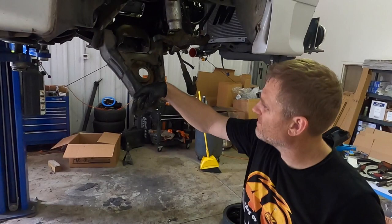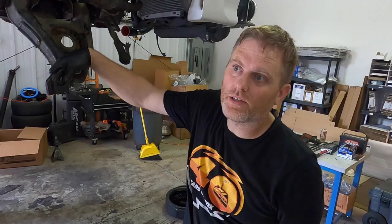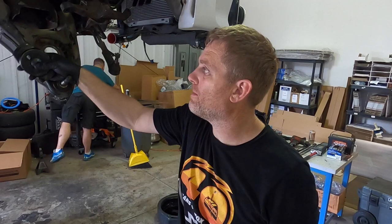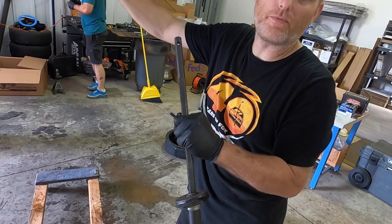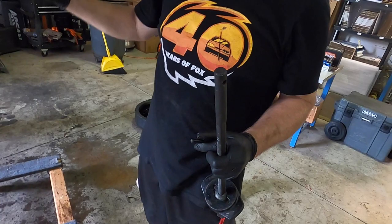We're going to do a little bit of how-to in this. Rob's tearing the motor down there, so we get back to that in a second. But Matt's got a tool — they're putting lowering springs back in here. I've had coilovers in my car but this is a little different. Basically it's the tool you would use for not just lowering springs but just any spring. It's pretty much impossible to install stock springs on a vehicle with the upper and lower insulator without using this tool. This tool is an OTC tool designed specifically for the Fox bodies — it's designed by OTC for Ford, and this is what Ford used in the service department. Basically, it goes through the middle of the control arm and the middle of the spring and compresses the spring to the control arm as one unit, so you don't have to worry about the spring coming loose and taking your head off.